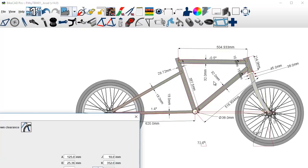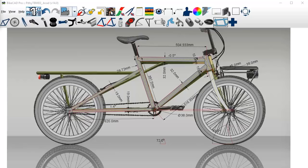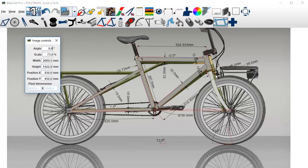The rest of the numbers are not a big deal — they're not going to affect the rest of the frame geometry. Now that I have the wheels in here and my fork set up with my actual real-life fork, I'm going to bring in that concept image. Here's the photo — look at that. So I have the long tail concept in here from before. You can already see differences, and you can see these are the BMX forks versus the forks I have now — we have a lot more rake, which is going to make the bike a little less responsive. I think that's actually what I want.